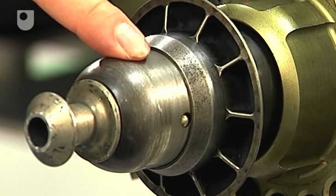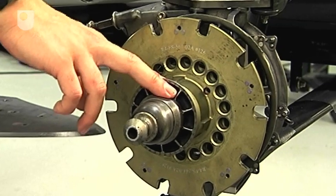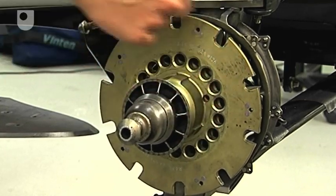Having removed the wheel we can now see some of the componentry that is associated with the load path that carries the load into the chassis. Here we have the hub which is the component we are concerned with a bit later on. And that carries the load into a component which we call the upright which carries the brake caliper. And beyond that is the component that holds the brake disc which isn't actually here at the moment. It would actually sit around the outside of here.